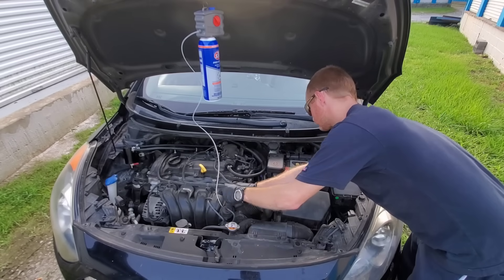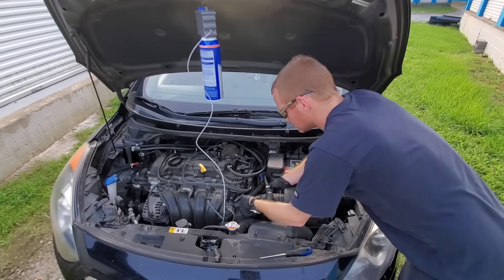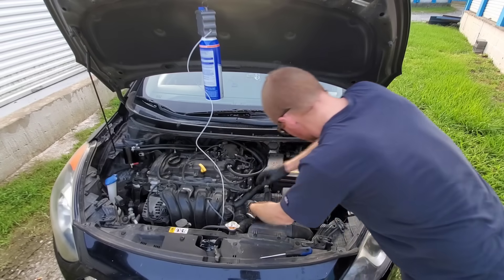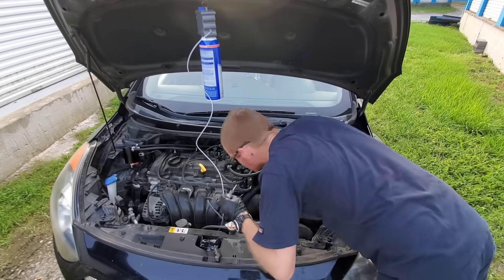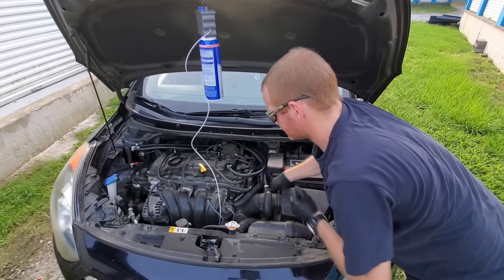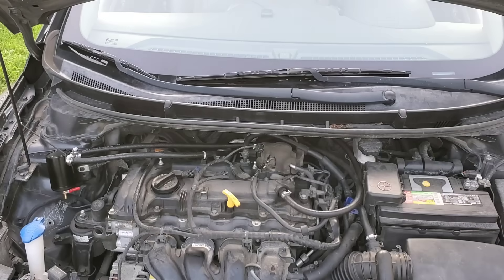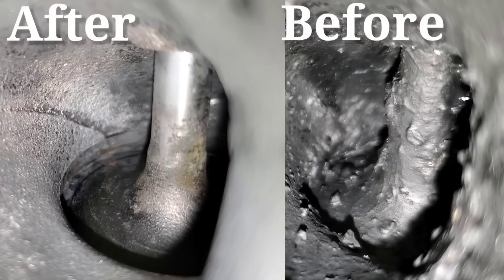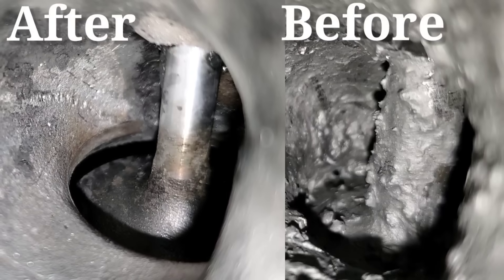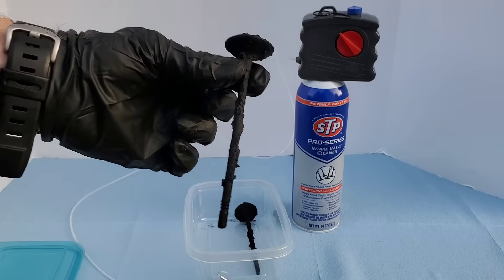The next step: loosen this boot back up to remove the straw, place the boot back on properly, align it, and tighten everything back up including the air box — don't forget — then move the cleaner out of the way. Now it's time to go back inside the engine to see how well this did or didn't work. And as you saw in the beginning, this was incredible.